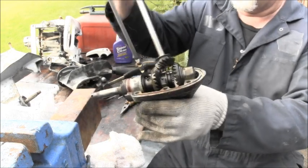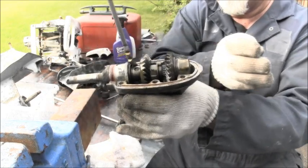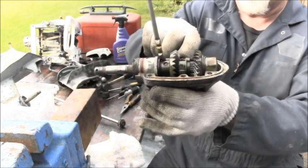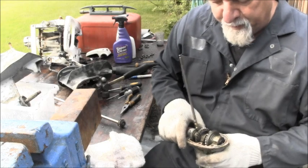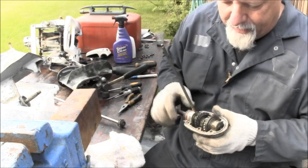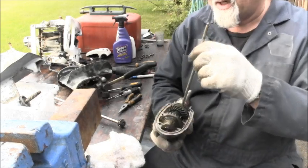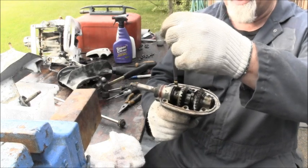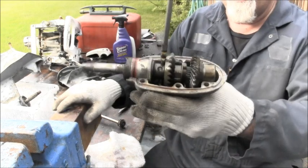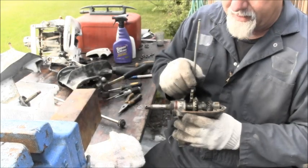Okay, and then when you shift it back and forth, the clutch dog inside here goes to the inside of those big gears there and catches lugs on the inside. So that's the whole setup on a 1960 to 62-ish, and even later and probably earlier, clutch dog and gear setup. And I think the 9.5 will be virtually identical, just bigger.